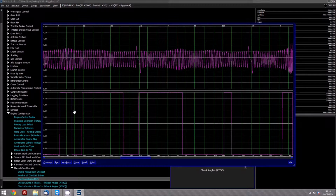So what you need to do is find a place in the log which you can take as a kind of checklist entry point. Looking at the log here, we need to find a point where the teeth are separately different. Now, looking at this in the middle, you would think straight away, if you just split the graph straight down the middle, you can tell the ECU that there are, say, three teeth on the one cycle of the engine and only one on the other cycle. And that's actually the correct thing that needs to be done here.